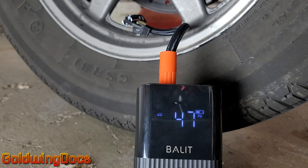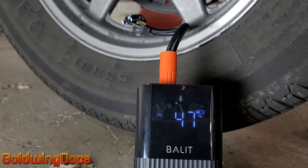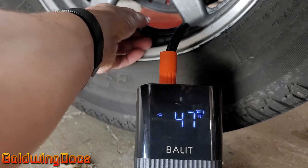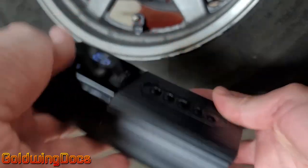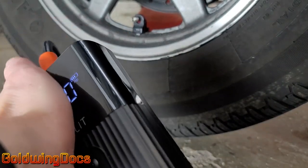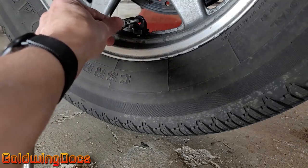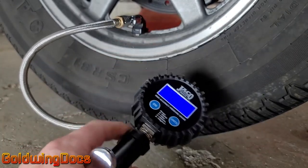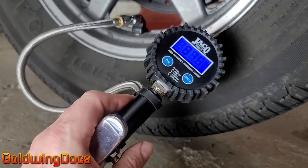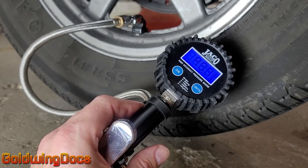I had my doubts as to whether this was actually going to do it, but it has reached 47 PSI. It says it has about half the battery remaining. That took 24 minutes. Let's take the valve off, hose, and chuck. It's actually all very warm — not surprised, there's a compressor in there and a lithium-ion cell being drawn on quite heavily. Let's put on my good air chuck and see how accurate it is. My chuck says 51.5, so the accuracy isn't great. I'm going to bring it back down to 47 where it should be. So it did over-inflate by about 4 PSI.